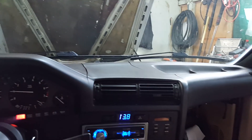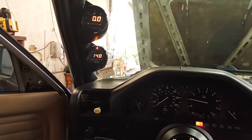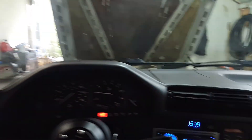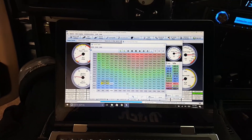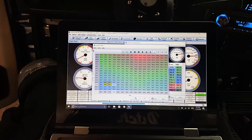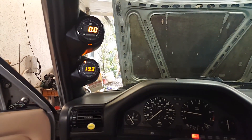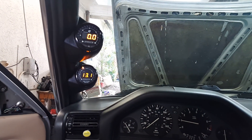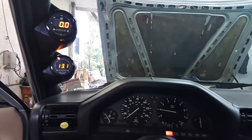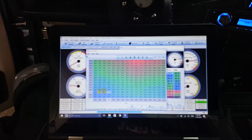Got everything wired back up with electrical tape, the wideband sensor is going in, and we're ready for the first startup with the wideband installed. Looking pretty good. I messed around with the idle air control valve and the fuel table a little bit and realized that around mid-13s is where the car idles best — so it's a start and it's going pretty well.